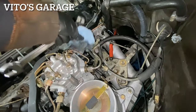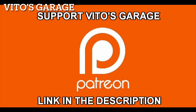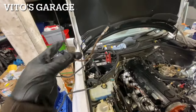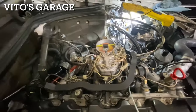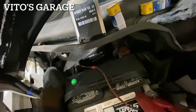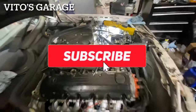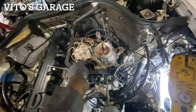I'm gonna swap this fuel distributor. Okay, another fuel distributor is installed. The mass module is removed and I'm about to jump pins one and two to activate the pump. I just activated the pump — look, we already have fuel coming out through here. That's a good sign, and we're gonna check to see if we have fuel coming out of that other outlet too.